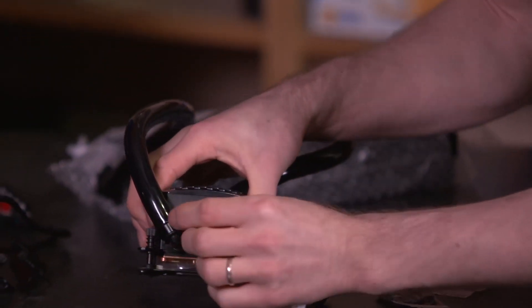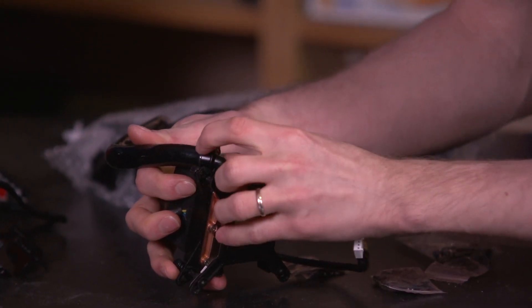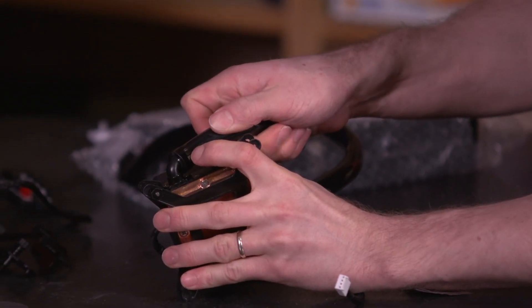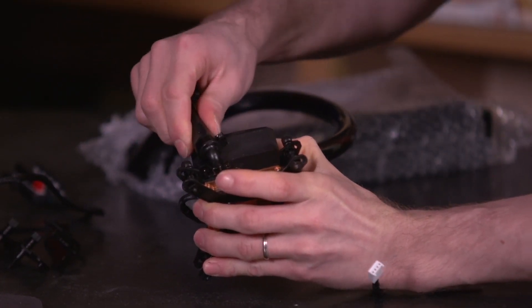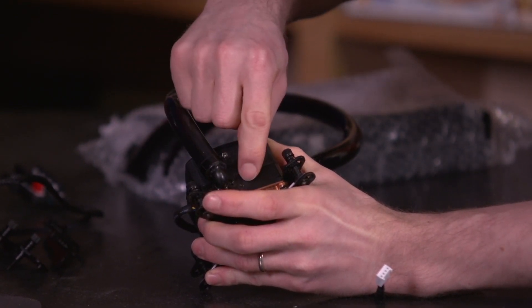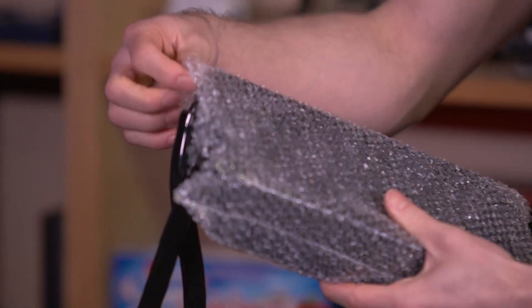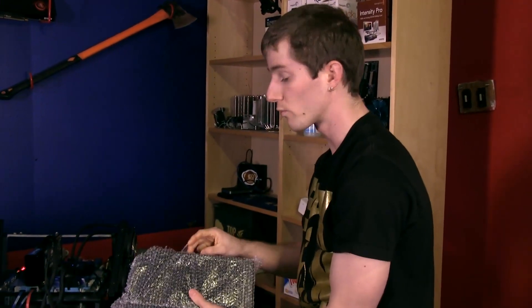Check out this hold-down — it's a custom worm-drive style clamp with a very slight bulge. You can see the lip on the fitting itself and the way the clamp fastens down tight, so you don't have to worry about over-tightening or under-tightening; it can't go anywhere. It uses a standard Phillips head, and the inlet is labeled. If you wanted to, you can actually remove this and plumb it up to a completely custom water loop — an option the existing products on the market don't really have.